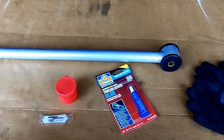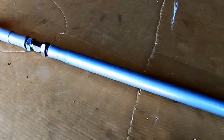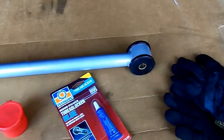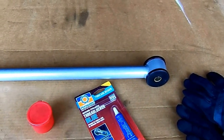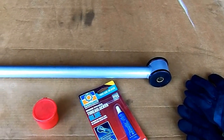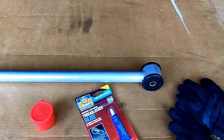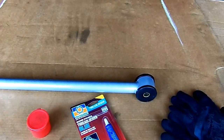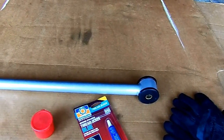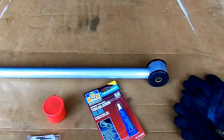This end is the one that goes on the driver's side — the adjustable side is the driver's side. One of the nice things about having it on the jack stands is that the weight of the body is on the rear end, and I can see where it's going to line up and adjust it while it's still up in the air. It will be very, very close to how it will be when sitting on the ground because it's got the weight on it.